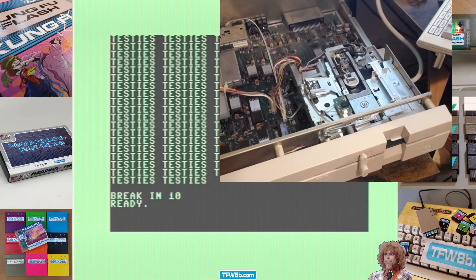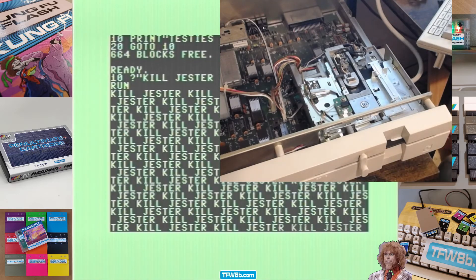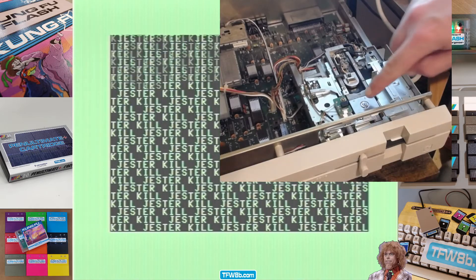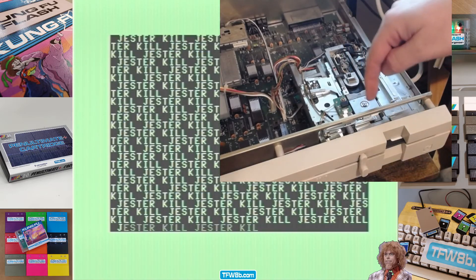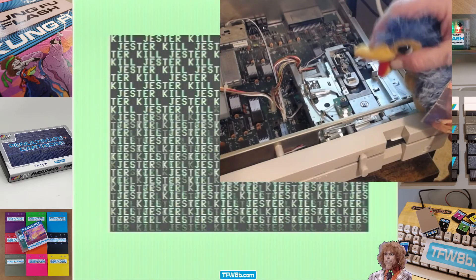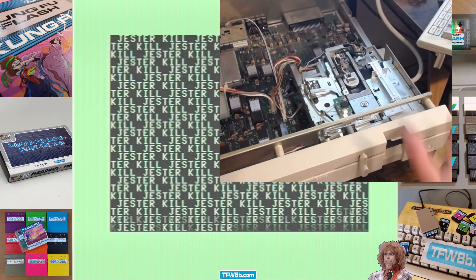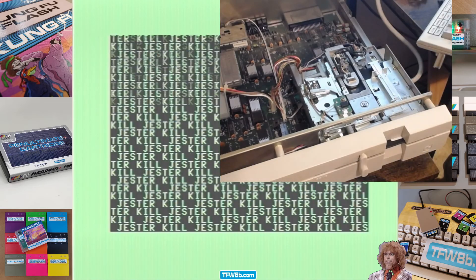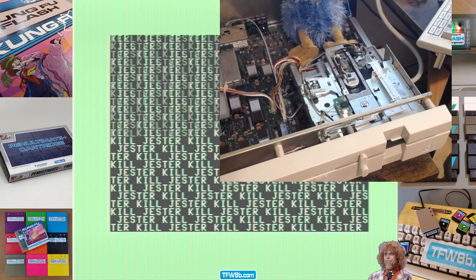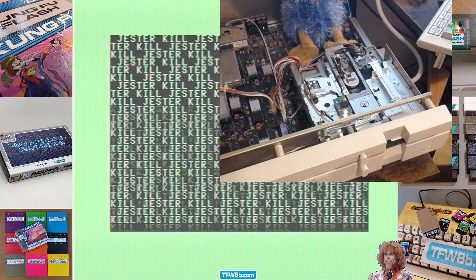Let's do a fresh program though. List, and we're going to go 10 print - I just like the keyboard on the 128, so good. So a bit of a pointless video because you didn't see much - basically noisy drive, a bit of dry lube. I took the circlip out and got the lube in the back of the tensioner spindle thing. I should really use mini emu to do that. Had a bit of oil in there and I cleaned the head using kitchen roll and some 80% IPA. Because this is a 1571, I really need to check that both sides of the disc work properly, and I will do that, but I won't be doing that now. Anyway, that's our video - there'll be another video shortly. Like and subscribe. Bye.